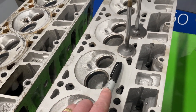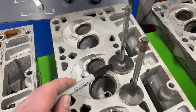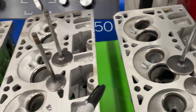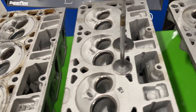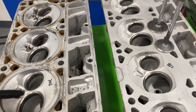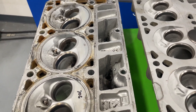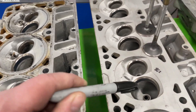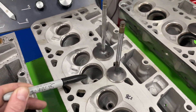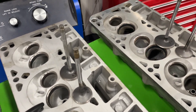This actually has a 1.55 exhaust valve, but the intake valve is really tiny at 1.89 — that's a small intake valve compared to the 2-inch that comes on the 317. However, both have the same exhaust valve diameter, so that'll be interesting. I've cleaned up all these heads. The port that's going to be flowed is clean. I'm using stock valves the same way you'd get them from the junkyard, just cleaned up — that's how they're going to be flowed.